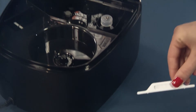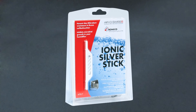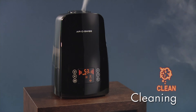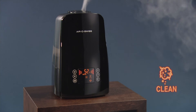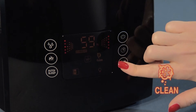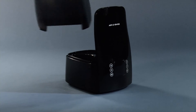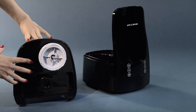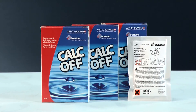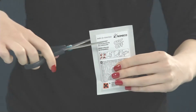The ionic silver stick must be replaced once every season. The cleaning icon is a reminder that the unit has to be cleaned. The cleaning is easy. Turn the unit off, disconnect the power plug and remove the ionic silver stick. To clean the unit, we recommend to use exclusively Calc-Off, which is especially composed for air humidifiers.